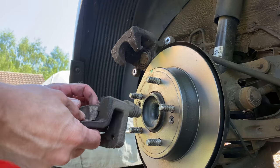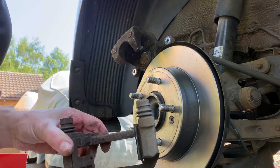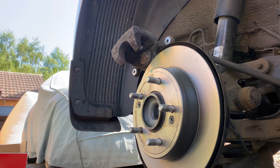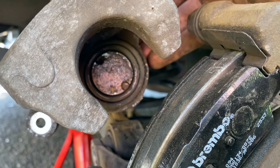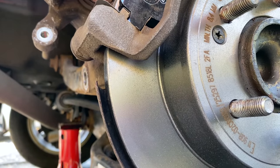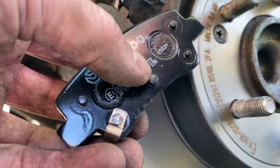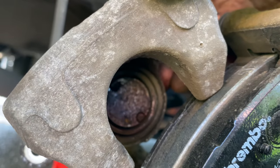That should be far enough, so we can take the old pads out. What I'd usually do is get a wire brush and just clean off some of this excess brake dust and corrosion. Something I forgot to mention: those two little holes there - when you push back the caliper piston, you need to make sure that the bottom one is kind of in the center bottom. That way it will line up with the tag here in the pad. If you don't do that and you reassemble everything, you'll find that the piston's just pushing on that little knob on the pad because it hasn't seated properly.